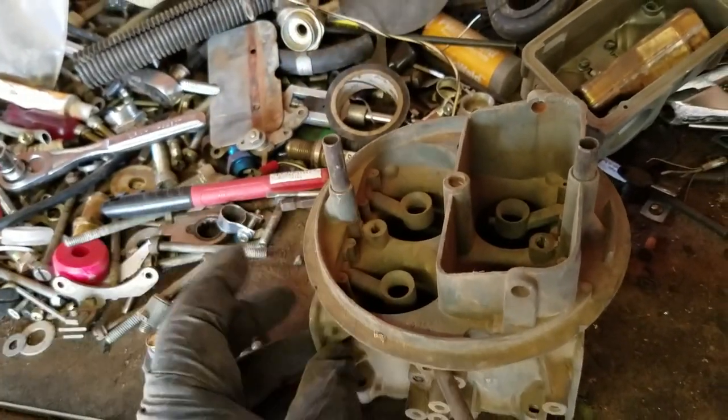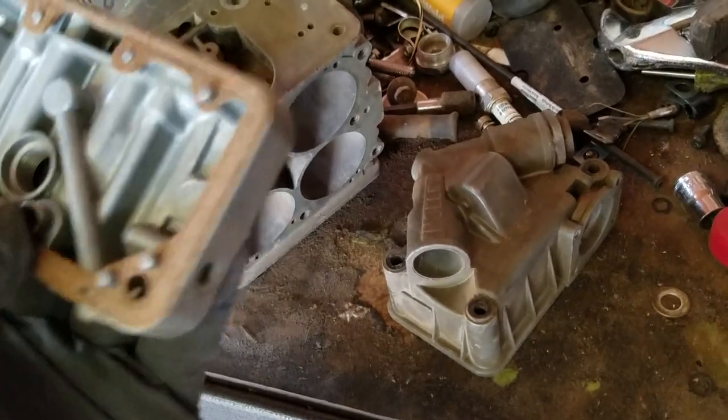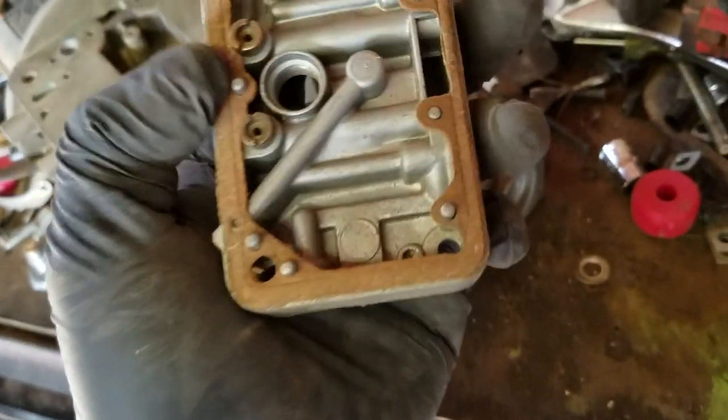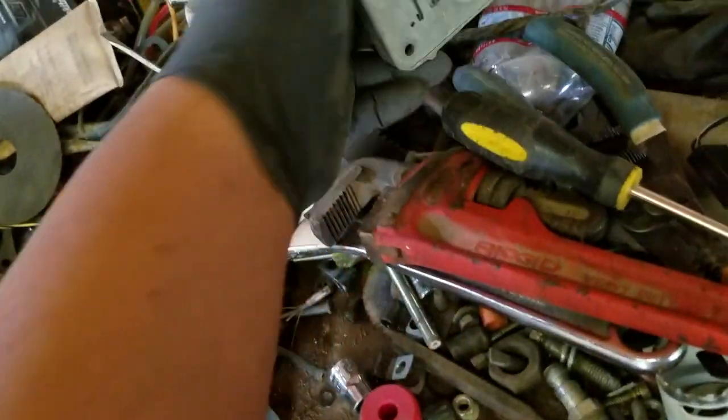This thing didn't have a secondary metering block, so chances are I'm going to have to source that. What's weird is that this secondary metering block was on the primary side, and this primary metering block was also on the primary side — but it had 76 jets in the primary and this funny power valve. This metering block has an idle capability but it doesn't have a fitting for ported vacuum, which I find a little odd. So I might not actually be able to reuse this metering block — I might have to switch over to a more standard one. This might be like a secondary metering block or something, but it doesn't look like it belongs.